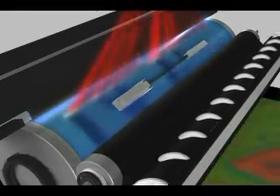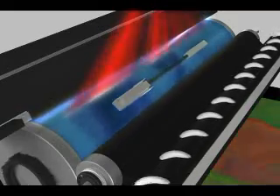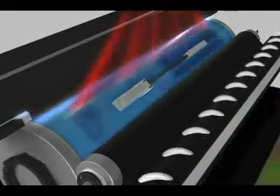As you can see here, we show the blue photoreceptor in operation. The laser discharges the drum so an image can be created and then deposited onto the intermediate belt transfer. This image is then moved on for imaging onto the paper.